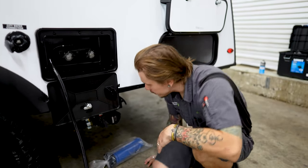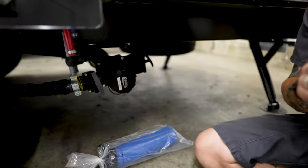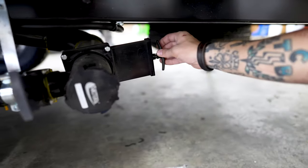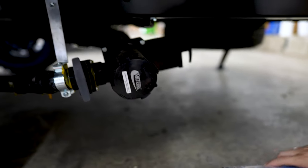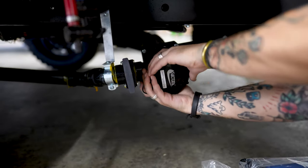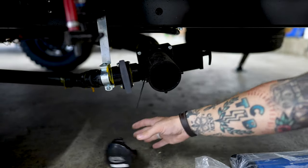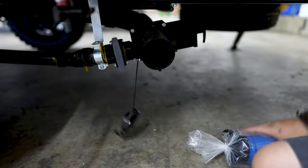Also here on the underside, we are going to find our bayonet fitting and dump valves. They are color coded — gray for gray water, black for black water. Gray water is going to be anything that comes from the sink or the shower, and black water is going to be your toilet waste or body waste. Right here in the center, we have our bayonet style fitting and we are going to connect our sewage hose the very same way this cap comes off. If I go ahead and rotate this off, you can see that we have four prongs here along the outside. On this particular model, we have four keyholes on the cap, and on the sewage hose, we have two keyholes.